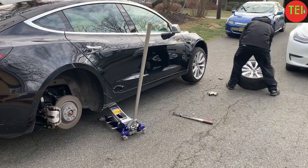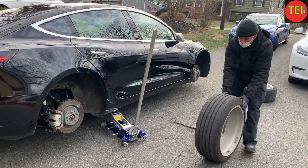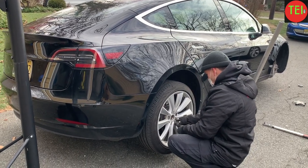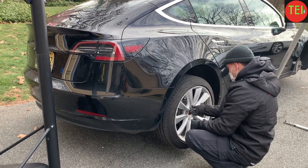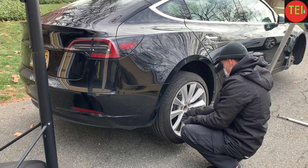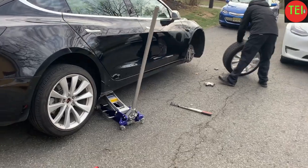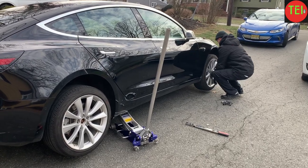Front goes to the back, back goes to the front. When you put the bolts back on, put them in by hand first, then go crisscross — you don't screw one next to the other, you go one tap, then across, then across and across. This way the rim sits nice and flush against the wheel. Then he takes his cordless drill with the bolt head and screws them crisscross from each side.